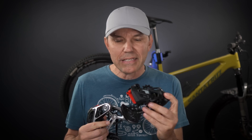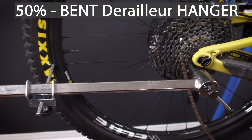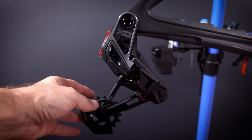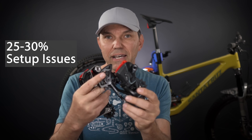With my videos I did my best to educate you all on how to install these devices properly and make them work. However, if you listen to SRAM customer service, they're going to tell you that out of 100 bikes with issues on the Eagle drivetrain, 50% of those will have issues due to their derailleur hanger being bent. That's why on the new derailleurs we don't need a hanger anymore — they are direct mount, or full mount as they call it. The second thing they're going to tell you is that another 25-30 bikes out of that 100 will have issues with the drivetrain because the B-gap wouldn't be adjusted properly, the limit screws will be all out of whack, and all that kind of stuff.